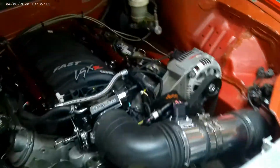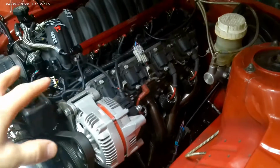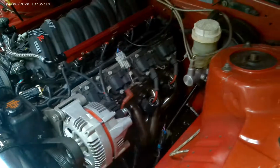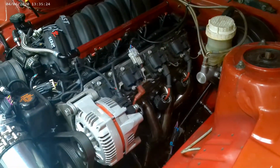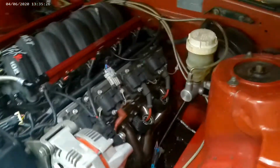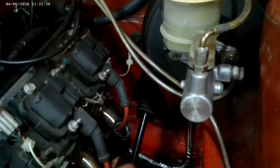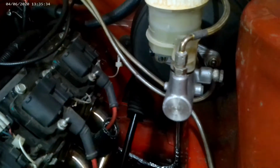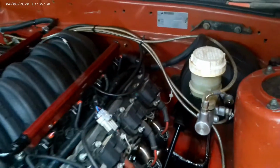One of the bummers about it was I put the steering rack in a slightly better position, but it changed the angle of the steering shaft, so I had to chop more out of my little subframe stubby there. And then I also had to elongate the hole in the firewall. I put a rubber boot on there. That's all tight in there. I just have to fill in some of the gap now. But that'll turn out alright.